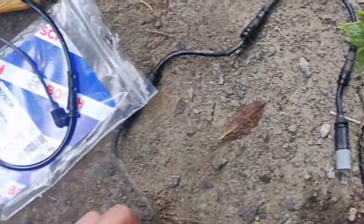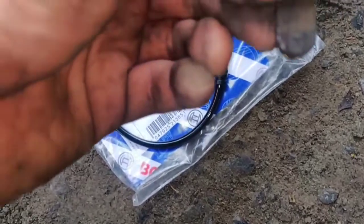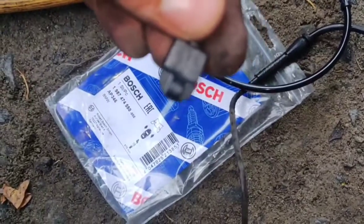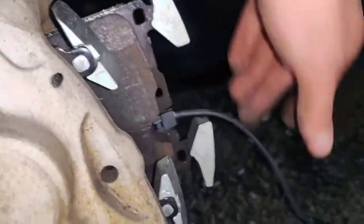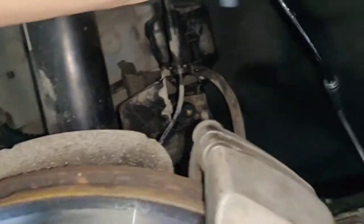Then you have to do the same but in reverse order. Just one thing to keep in mind: you see this tab on the sensor — there is none on one side but there is one here, and that's basically your indicator that the brake pads are worn. Make sure you install it correctly — this part has to go on the inside of the brake pad. Push the sensor in like so, just make sure that it clicks and sits in there snug. Push against this plastic bit because it's really tight there. Then route the wire to the bracket and to the connection, and close it up.